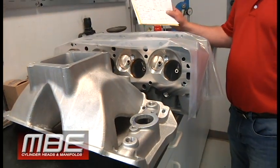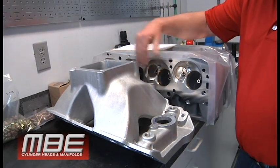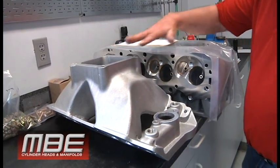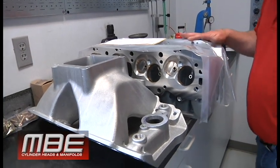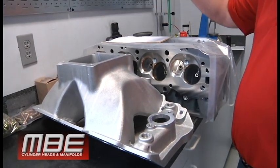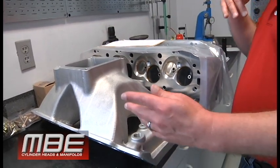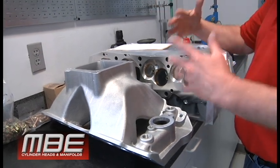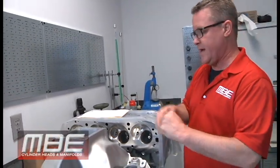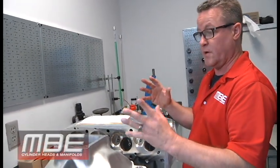Actually this is our 18-degree conventional head — these are just about finished, we're just waiting for valve springs. This is a good deal: we're using the M&M casting with the MBE 18-degree head. This is great because if it runs a lot of RPM or a lot of cubic inch this manifold will work, but if not, we'll put you in a different manifold that fits your application. We have three options on this — for large cubic inch or 500 or smaller cubic inch like a 500 truck puller.